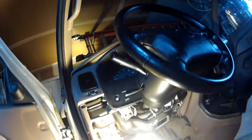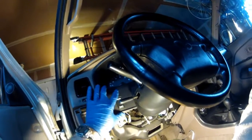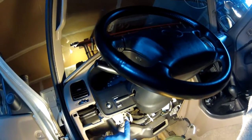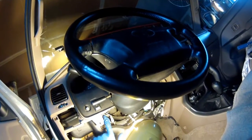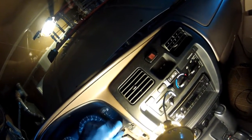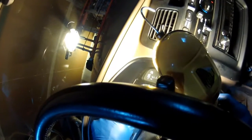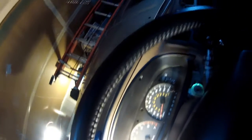Now that I've checked to make sure the bulb works, the next thing is to put in the four Phillips head screws that hold this piece onto the dashboard. Number one is right here — this little tab goes back here. Number two has a little plastic dowel it slips over to help you find the screw hole. Number three is up at the upper part, and number four is right here. Those four screws secure this plastic piece to the dash.